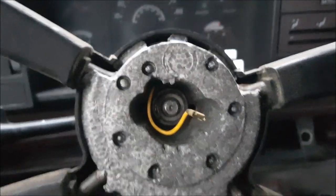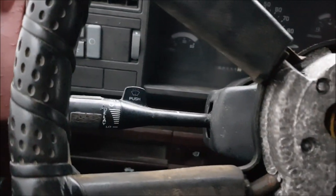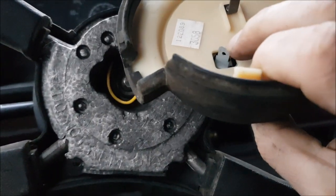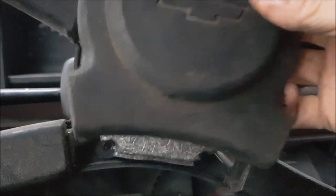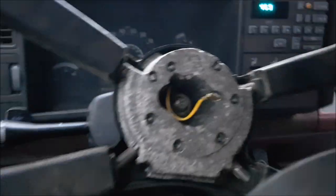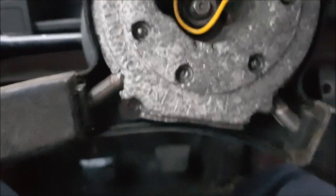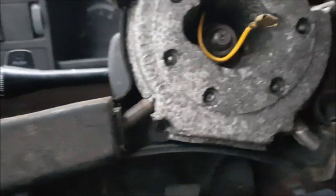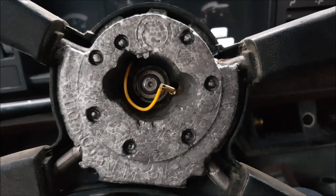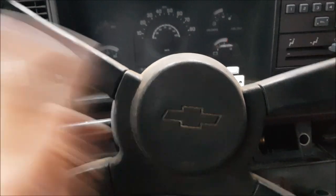This is your insert, and then your horn switch, which is this plate that goes on top. There's the terminal that the horn wire connects to. This clips in place and there are two screws that come in from the back side — two seven-millimeter screws that come in from the back side to hold this horn button in place. So I'm going to go ahead and hook up this wire and then stick that button on.